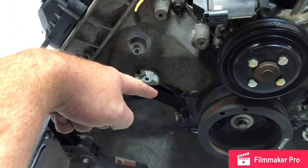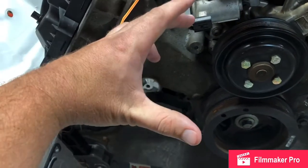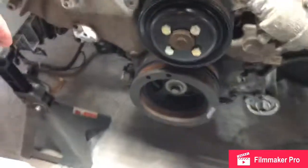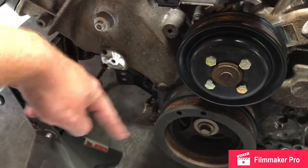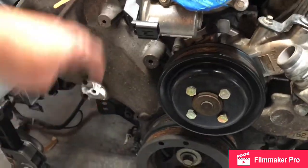I'm a little concerned — I ordered it, it's not here yet — the Blowfish Racing power steering pump bracket. I've seen some of the Ford Performance ones that go in the same spot that are adjustable and don't use the stretchy belt. They hit the sway bar, so the sway bar comes right through that territory somewhere. I hope I don't have sway bar clearance issues, but if I do I'll just space it or figure something else out.